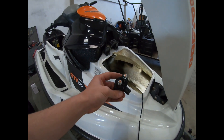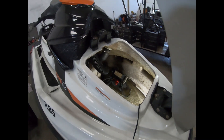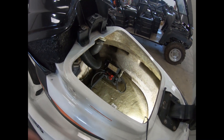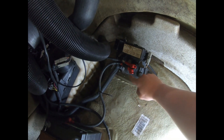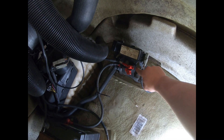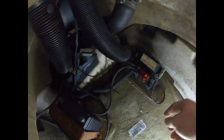Today I'm going to make a quick video showing you how to replace the starter solenoid or starter relay on a Sea-Doo 4TEC — that would be the GTI, the GTX, the GTS, and many others. Right here is where my old starter relay is; here's the power input and here's the power output. I also have a separate video showing how to diagnose a bad solenoid.